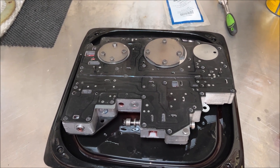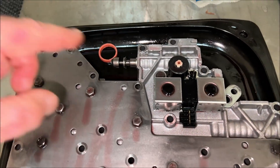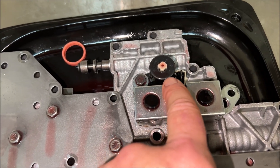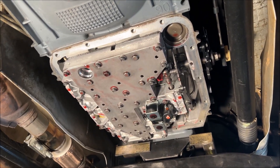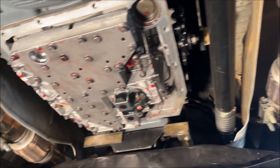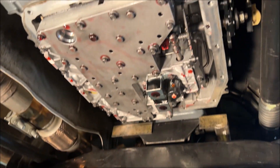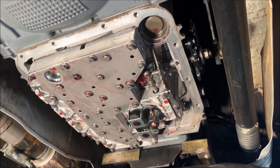Out of curiosity, I'd be interested in the comment section below if you think that one little valve is going to make a big difference in the torque converter lockup performance. Incidentally, I've got another video about the failure of these solenoid packs — I believe it's called A and B — and I'll link that in the description. There is your torque converter control solenoid that controls the fluid in that circuit we just modified. The valve body is back in place and I've used a torque wrench to torque all bolts from the center outward to 96 inch pounds. While removing the electrical strap, I broke it, so I bought a new one — I'll link it in the description. I also got a new Motorcraft filter, which I'll link as well.